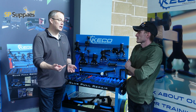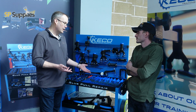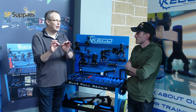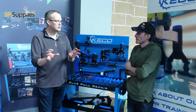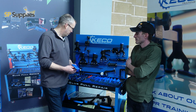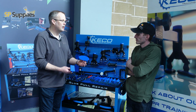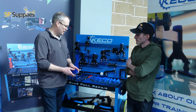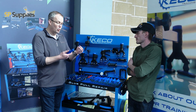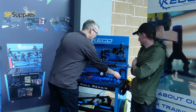We've seen a lot of times where aluminium's been used and it's been torn in repair. You're not going to tear with this because of the surface area. You're not point loading a pull, you're getting a nice, evenly distributed pull. Some of the tabs we've got go from this style, 6 square inches, right the way down to a little 5mm dead center, and these all work. Obviously it needs to be in the right scenario.